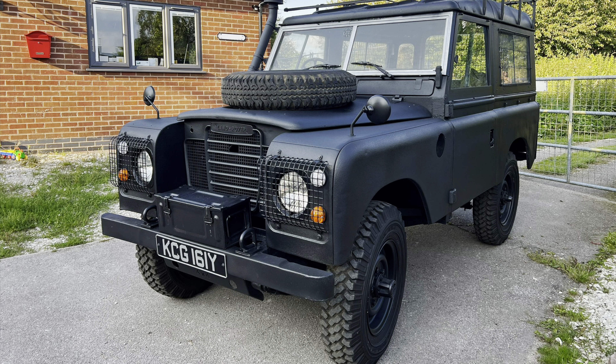What I'll do now — and it'll be another day — is put the rocker cover back on, which has had some paint and can't go on yet. Then I'll put the manifold back on with the new gaskets, and in a few days time the carburetor back on, water pump, and I've ordered a new thermostat because I checked it and it wasn't working properly. Then we'll put it all back together, get it firing up, and hopefully at the end of this video — albeit a few days after this recording — you will see the engine running.